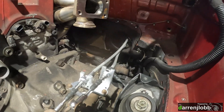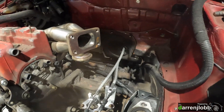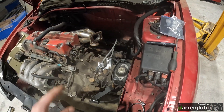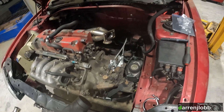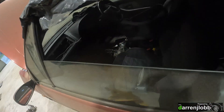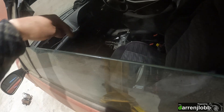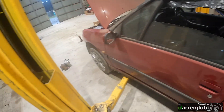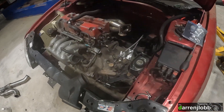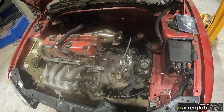I've got those two holes put through the bulkhead now and just temporarily fitted those two cables so we can get the length sorted, with a couple of temporary grommets. That should be well out of the way of the downpipe and turbo and also give plenty of clearance for heat reasons. They are a little bit longer than they ought to be really inside - the way one's bent around I'm just going to have to make a loop around the centre console or something. I need to make that loop as long as possible to avoid too sharp a bend.